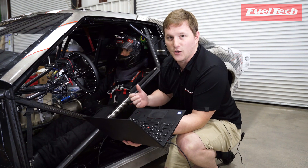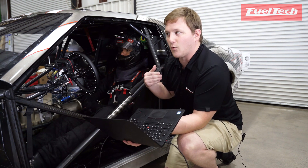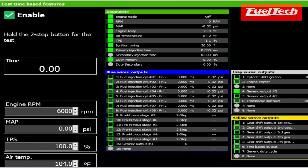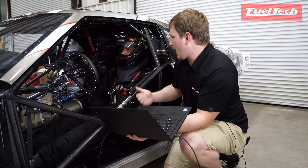When we turn this feature on, it's going to turn the trans brake on, and then Louis is going to push the trans brake button to turn it off — and then it will run through all the features just like the car's going down the track. Let me get this set up here — we're going to turn that on, there goes the trans brake solenoid. We'll tell it that it's going to be at 7,000 RPM, and then whenever Louis is ready he can go ahead and do his run.